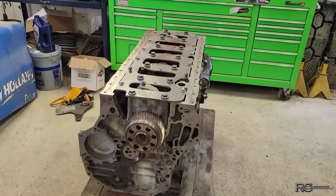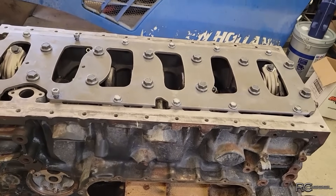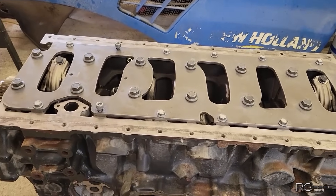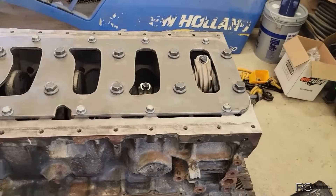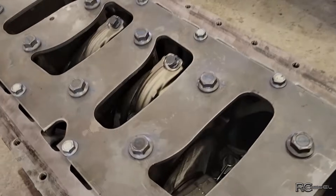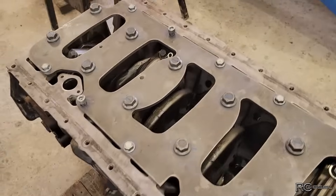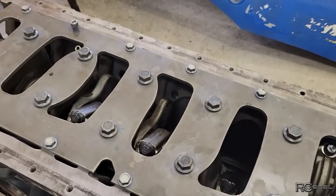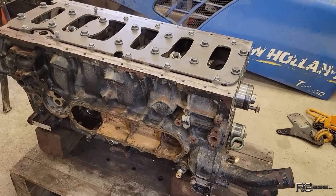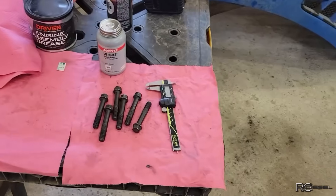Rotating assembly is assembled. We reused the pistons, put new rings on, honed up the cylinder sleeves, reused the sleeves. New rod bolts though — I don't like taking chances on those ones. Everything measured out good, torqued up good, engine rotates really well. It's a little bit stiff, but I do have it full of grease and new piston rings and all that kind of stuff. Those piston rings have a lot of tension on this motor, so it actually turns over really nice. Don't worry about those leftover pieces — that's just proof that I made it better.